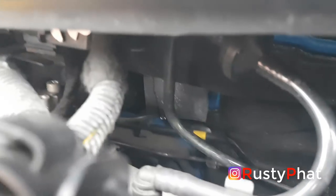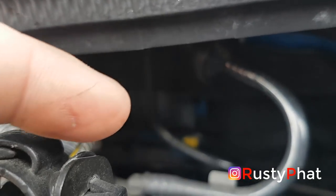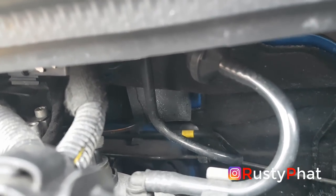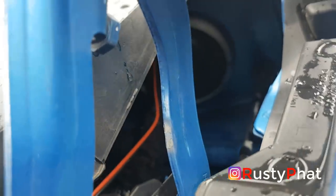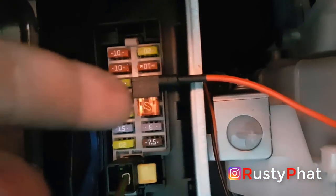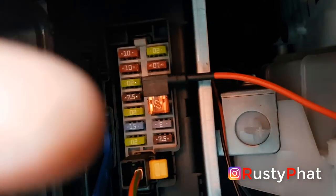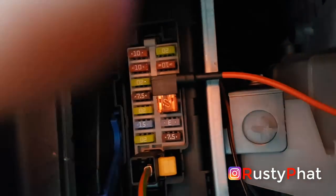We then followed it up here, put another tie wrap here loosely - I might add, because you don't want to squeeze your vacuum line too much. Then if you look under here, it goes up through the middle - there is a little bit of foam there, it's where the water can drain off if it gets underneath here. We've gone through the grommet on this side, just through there as you can just see slightly - it goes straight through that, which then comes straight through underneath your glove box and in here. You've got your fuse box cover - you just put something under here to wedge it and pull forward. We've put a piggyback fuse connector in, which allows us to add another fuse while keeping the existing fuse. We've gone for the third one down, which is only on when the ignition key is in the ignition - so we're not going to run our battery down. Very important: 7.5-amp fuse closest to the fuse box, 10-amp closest to us.